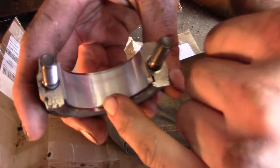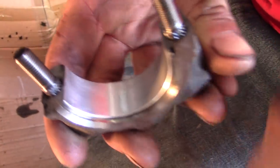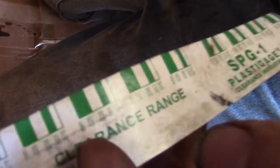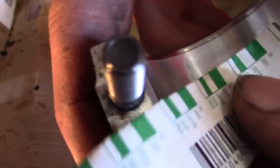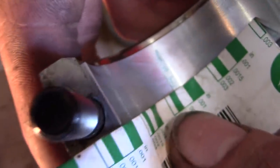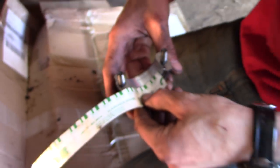So there on your rod bearing, that's the PlastiGauge. It's really hard to see — but I got it, oh yeah, you see it. So we're going to compare it with our thickness strip here. So for it to be within spec on this end, it's just got to be between one thousandths and three thousandths. Let's see what it is. This might be a little difficult to show — it's a bit of a guessing game. That's one thousandths there. It's a little bit smaller than one thousandths — I'd say it's pretty close to one and a half. Which is perfect, it's right within spec.